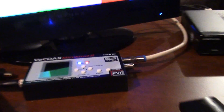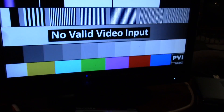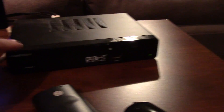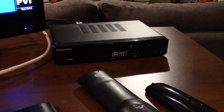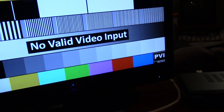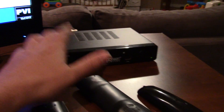One of the first things I've discovered is I'm getting a 'no video on input' color bar thing. Connecting it directly to the TV, I couldn't get it to work. So I ran it through my old homeworks box — cable running out and into the homeworks box — and I was able to scan the channel and confirm video input was working. For whatever reason, the tuner in this particular TV is not doing it.